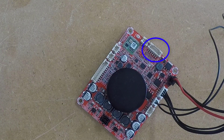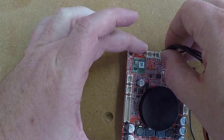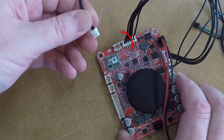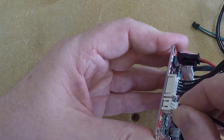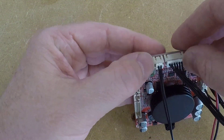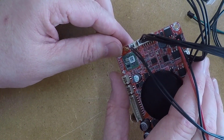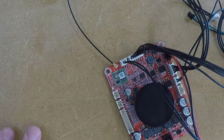Moving on to the top of the board, we have two connectors. The first one is the volume control cable, so we track down the volume control wire from the control board and plug that in. Moving counterclockwise across the top of the board, the next connection is the pairing connection — this is the green LED labeled pairing on the control panel. This cable has two black wires, and all of these cables only fit one way, so if you're finding yourself having to force it in, you've got it in wrong — turn it around and put it in the correct way. The last thing on top of the board is the Bluetooth antenna connection. It's a little bit hard to see — it's a little bitty brass knob that sticks out from the board. You just clip the Bluetooth antenna onto that and you're good to go.